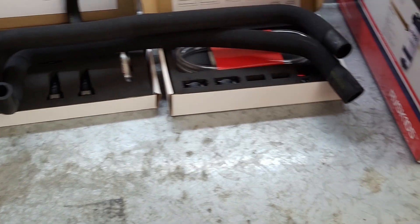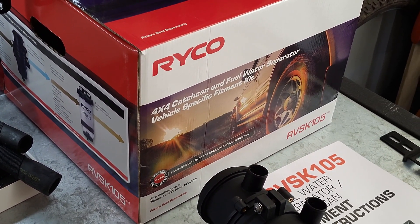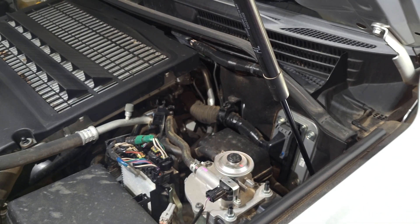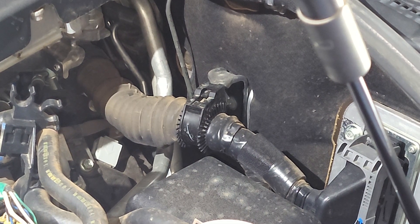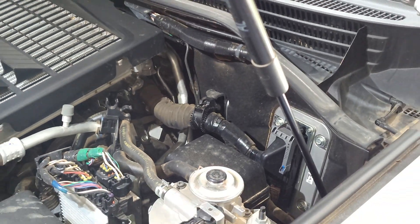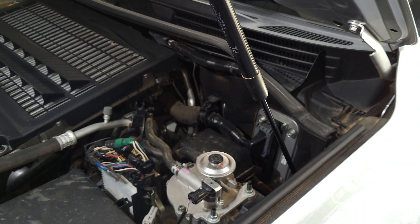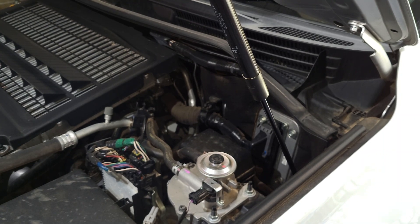Just got the car in the shed. As you can see, just down there where that cable goes through - that's where we're going to remove that bracket off the wall there. That's where part of the new bracket goes, and then obviously these two bolts here - we undo those, lift the factory fuel filter up, slide the bracket in there. By looking at it you just need a screwdriver, a 12 mil and a 10 mil socket or spanner.